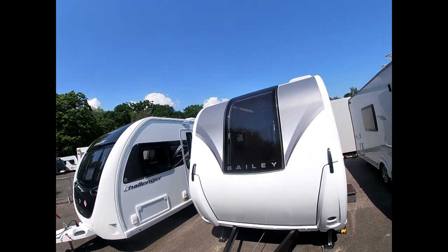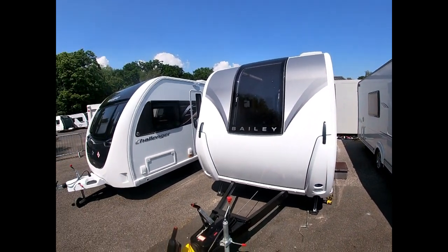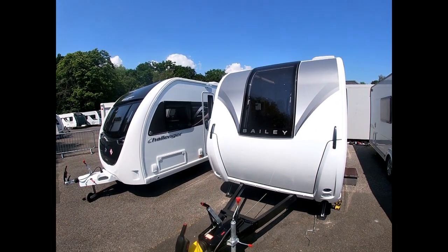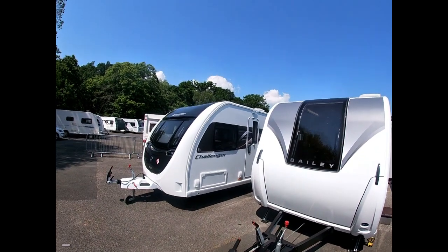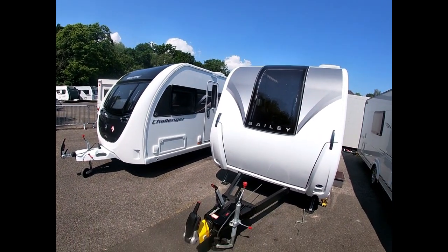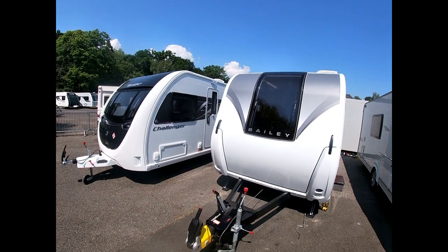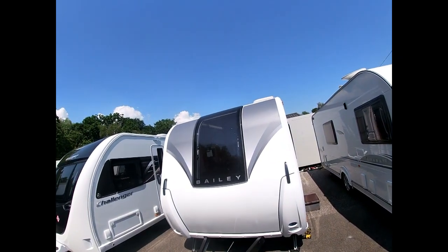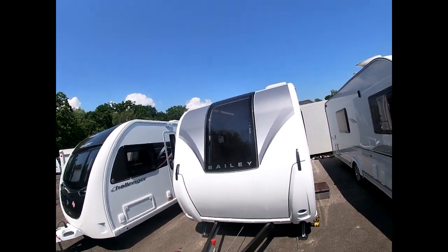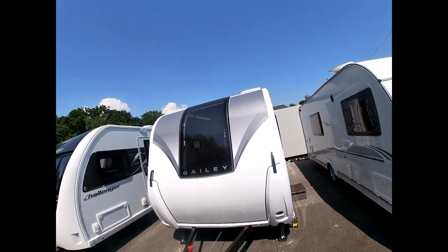One of those other things it does is it operates a fridge on 12 volts. When I'm travelling from A to B, C to D, I can select the dial on my fridge, which shows me a battery sign, but will only work when it's connected to my car with the engine running. And that's because it comes off the charging system of the engine to hit a little element in the fridge to make it operate. The other thing it does also is it charges my leisure battery.